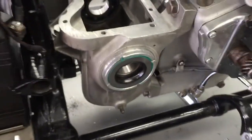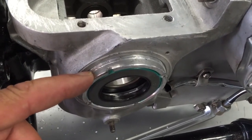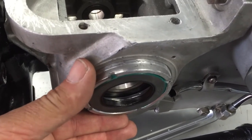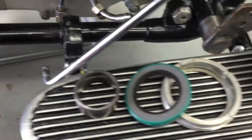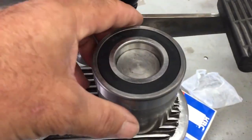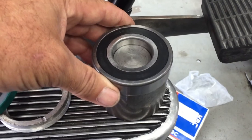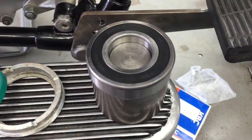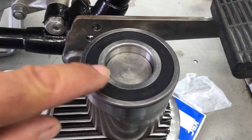Going around to the right-hand side — some earlier models have a different setup. This is a later model that's got a proper bearing retaining nut and a seal. This bearing retaining nut actually seats and holds the bearing into place, and it's a seal carrier as well. If you do have to tap a bearing in — you shouldn't really, it should be pressed — but in this application you can't get a press into the motorcycle. Always tap on the outside of the race, do not ever tap on the inner race.